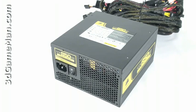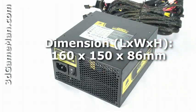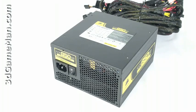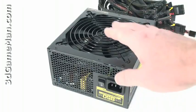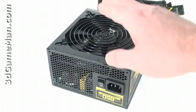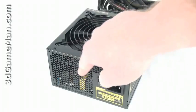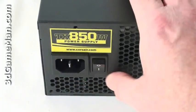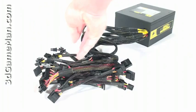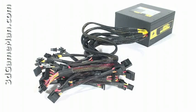Let's have a closer look at this power supply. Even though this is a high-wattage power supply, it's relatively short and will fit in most mid-sized tower cases as well as home theater PC and small form factor cases. It has a rough paint finish and a steel housing. It includes a temperature-controlled quiet 140 millimeter fan — the hotter the inside gets, the faster the fan spins. The 140 millimeter fan and honeycomb ventilation ensure maximum cooling, so this power supply should remain cool in almost any environment. Here's the power cord connection and the power switch. This power supply has lots of long sleeve leads, but none are modular. Modular leads are fantastic because you only use the ones required for your setup, reducing cable mess and increasing airflow.